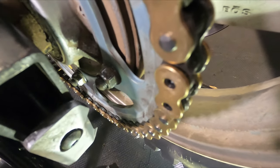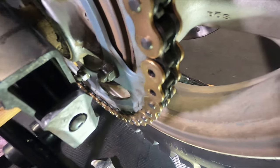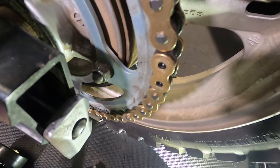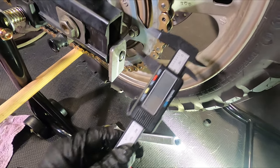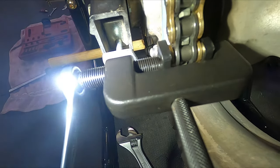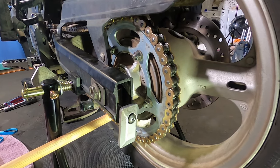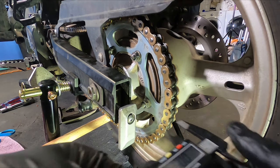I gave it one good squeeze, about a quarter of a turn to half a turn, just to make sure that the rivets are coming through the holes properly. Now I'll do that again. About a half a turn, half a turn, half a turn, a bunch of different times, measuring with a caliper to see how close we're getting, because you don't want to go too far. You can't back it back off. Go ahead and check it by eye till you see that it's going to get kind of close. We're a good distance yet. I've got it so that the rivets are popping out right here. And so I'm going to measure it.